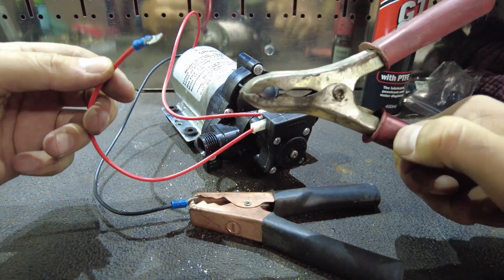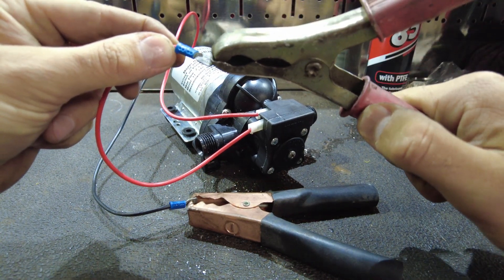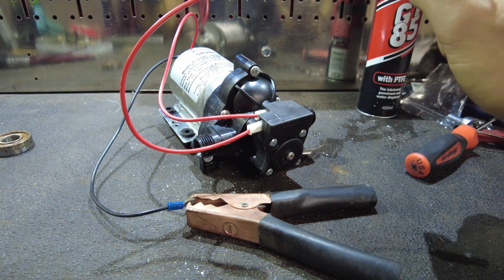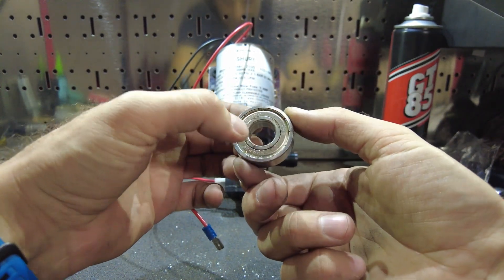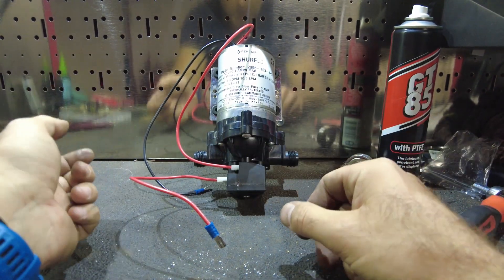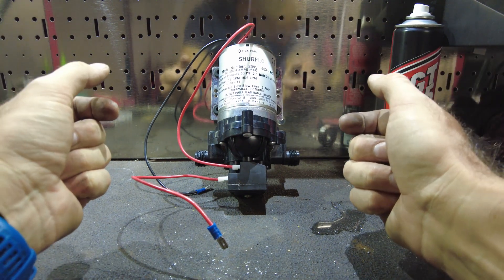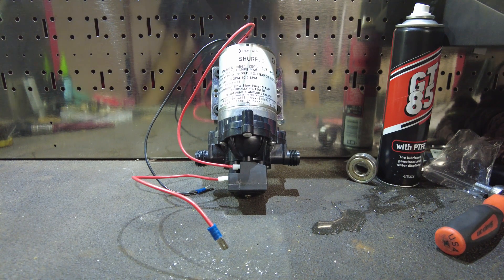I've got an old car battery and some jump leads. Oh, it still has some water in it — but there you go: one working pump. Sounds a bit awful because there's no water in it, obviously, and it's pumping air and it doesn't like that. But there we go. So that's another thing saved from the landfill for the sake of four or five pounds and half an hour's work. I've replaced the seized bearing that had got water in it and it's now working. I've already replaced the one in my van with a new one, but this can be kept as a spare just in case. Thanks for watching — please like and subscribe, it really does help. It doesn't cost you anything, and I'll see you again.